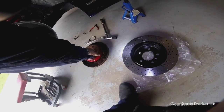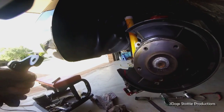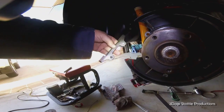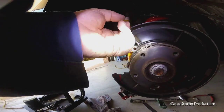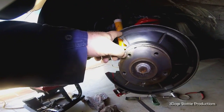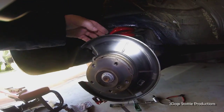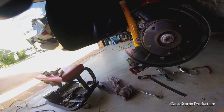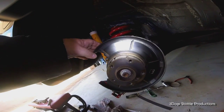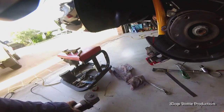It's significantly larger. Let's see if we can fit this up and see what we need to modify and change. Now we're about to mount this bracket - that is the adapter plate to go from side mount to radial mount. To do that we need to trim the dust shield on both sides and also trim right around this edge to get rid of that, otherwise it overlaps the rotor. At the moment the caliper is still hanging off but everything's all cleaned up ready to roll.